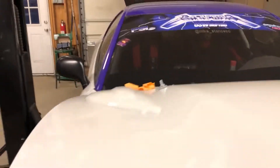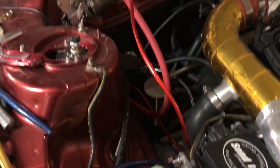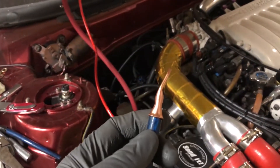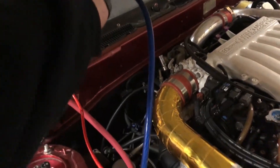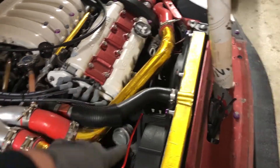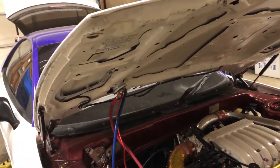Cut a hole, got it in, and now I'm going to start laying out where I'm going to put the cables. This is going easier than I thought. Oh yeah — that'll be perfect. Battery cable and the fuse block power cable — I'll pull any slack back through the firewall once I know how much I have to work with. I put this connector onto the starter cable — that should be everything I need to get this thing to work. Just got to notch a little piece to put the heat shield back around the starter, then we can try to get power through this thing.